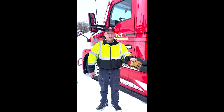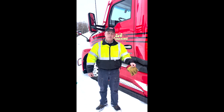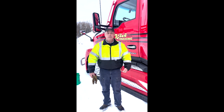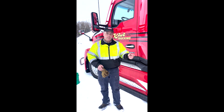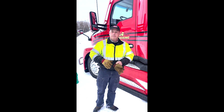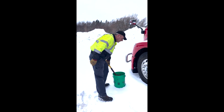If you do get stuck, your best chance of getting the truck rolling is to avoid spinning the tires. You want to do a little prep work before you attempt to move the truck in the first place. One of the things you can do is find some grit to put underneath your tires — either sand or kitty litter works good. A lot of drivers will carry a small container of kitty litter in the cab with them. It doesn't take much weight. We're going to use sand today.